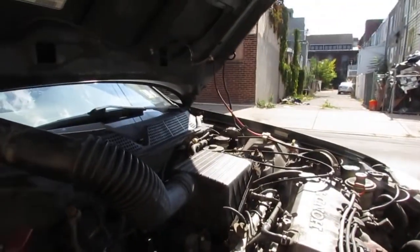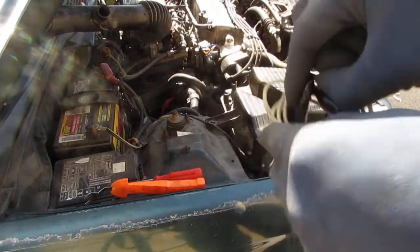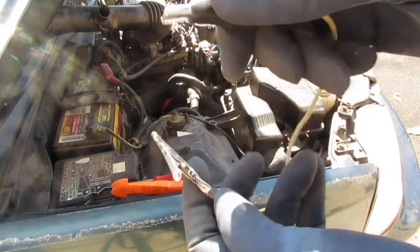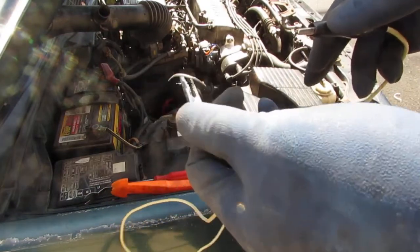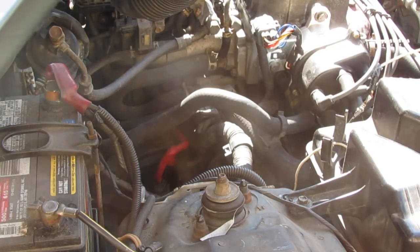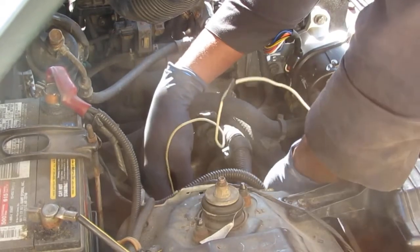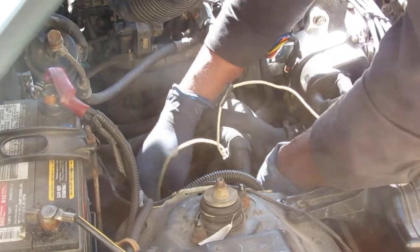Let's get a wire and cross those two over and see what happens. The starter should turn. So I'm using this wire with an alligator clip on both sides. I made this myself. You can buy them or make them, doesn't matter. All right, I'm gonna clip one onto that smaller wire in the middle of those two bolts. And this one on the, I'm gonna touch it real quick with the power on the starter itself. So all this test is gonna tell us is if the starter can actually shoot out. It doesn't give us a definitive answer on the state of the solenoid, but it's a good place to go. Connect to there. Okay.